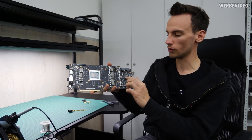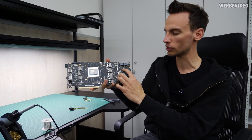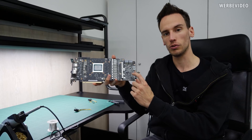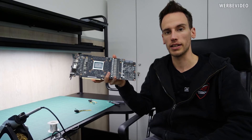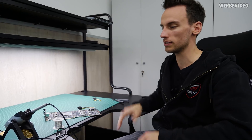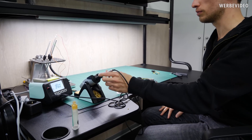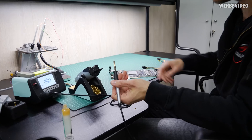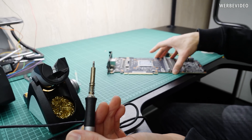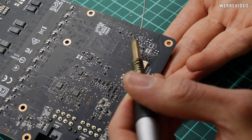Now for the power mods. We will add extra 12V power cables after the power measurement shunt resistors on this 2080 Ti Strix. The card has two shunt resistors measuring power across the two 8-pin connectors. Anything attached below them won't be measured. We have an additional 6-pin connector with three 12V wires and two ground wires — so additional power, for example an extra 100W, will bypass the card's measurement. We'll attach three 12V cables on the bottom of each shunt resistor and an empty solder pad. We'll also attach a 3-pin header to the empty slot for the I2C connector. Thankfully we have a Weller soldering station in this great workshop.